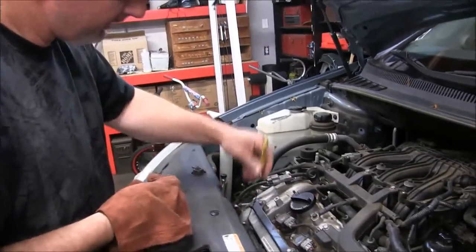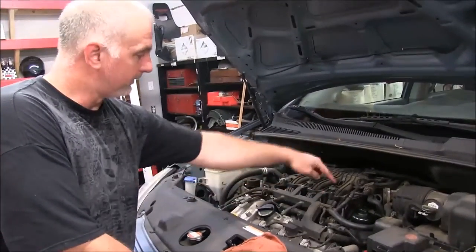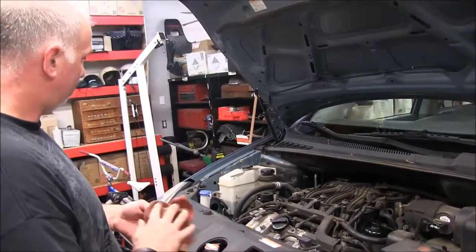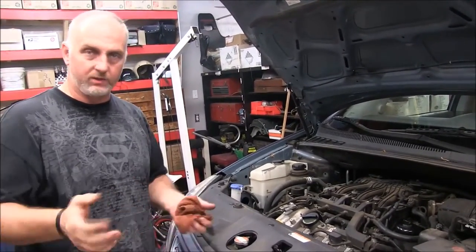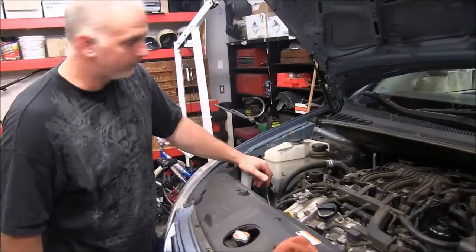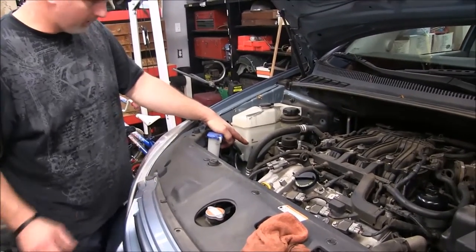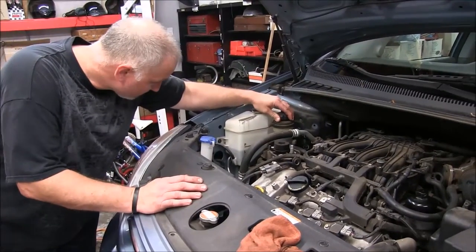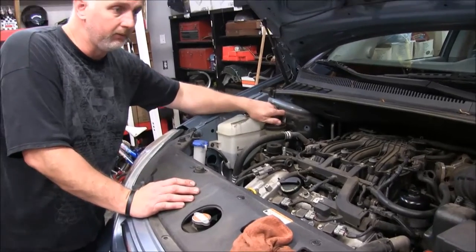That's about all you have to do to do an oil change. What we've got left to do here — we've got to take our little engine cover, stick it back on, put the four bolts in, and lower it back down. While you're doing an oil change, it's also a great idea to check some of your other fluid levels. We will top off our washer fluid, our coolant level is just a little bit low so we'll bring that back up to the full mark, and our power steering fluid level is a little bit low so we'll top that off too. Thank you for watching the video today — don't forget to subscribe and we will see you next time. Take care.